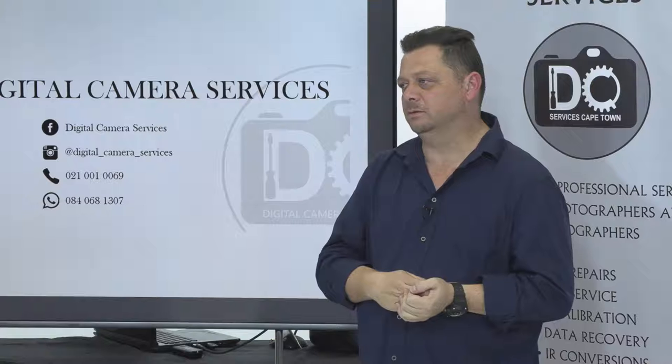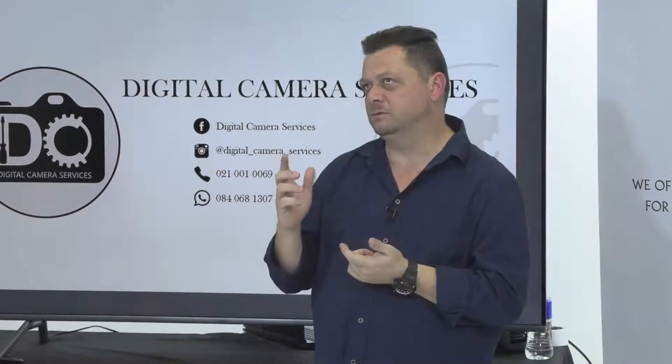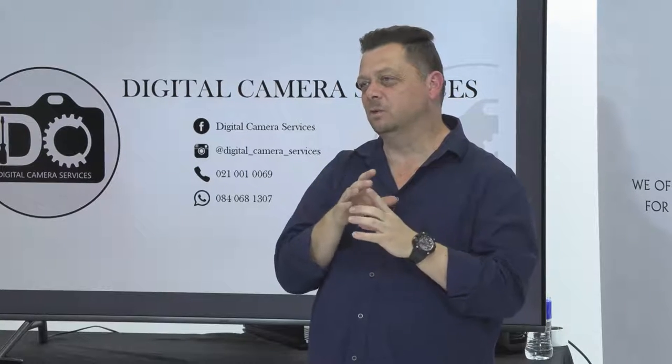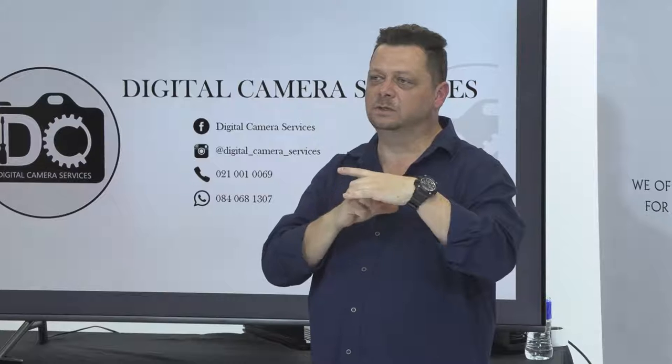On Canon's ultrasonic IS — some people say when you leave that mechanism on while switching the camera off, it stays active. If you take the lens off quickly without waiting about two seconds after switching off, your IS is still floating. VR, IS, OS — it's still floating. There's a mechanical lock that locks the lens in position when IS is off. When it's floating, it's bouncing around inside. There are springs, levers, magnets all loose and not under electronic control. When you turn the camera off, it does a mechanical lock to safeguard from that.